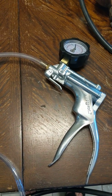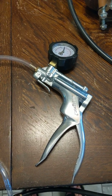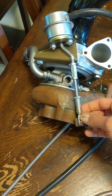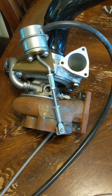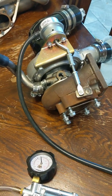I had to clock my turbos when I was installing them on the VG30DETT, and once you clock the turbos you do throw off the distance that the wastegate is set for, so they do need to be recalibrated to open up at the proper pressure. And since it's a twin turbo, we can do this individually one at a time, or you can hook them up and do them both.